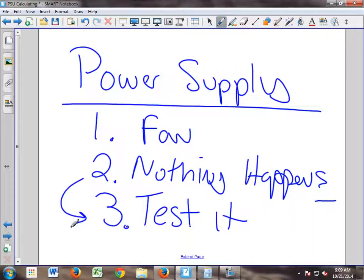We all, 4 out of 5, 80% of us, have taken out power supplies and put in power supplies, and how long does it take? Less than 5 minutes, super fast. It takes less than 5 minutes to remove the power supply and put it back in, right? There's only 4 screws. 1, 2, 3, 4. These are not screws you take out. Neither are these fan cover screws. Just take out the 4 bolting it into the case.